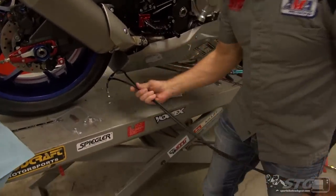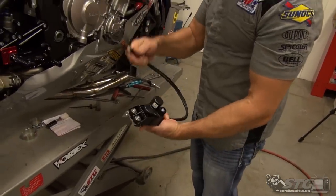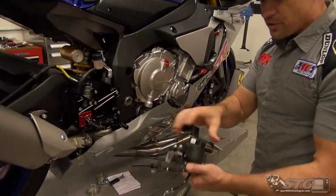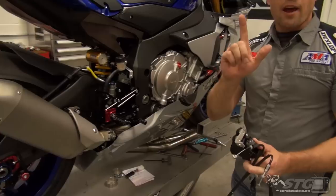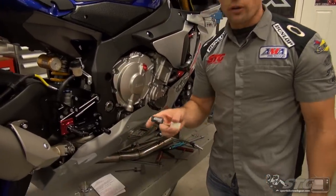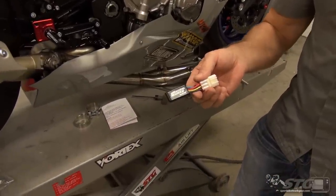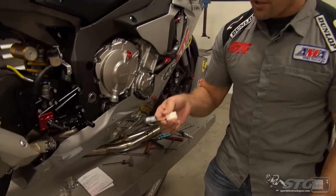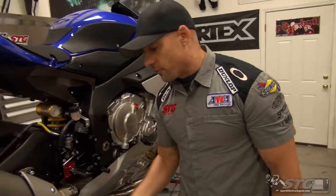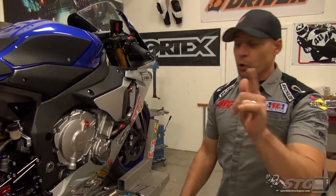Be prepared to deal with the exhaust servo as you go through the project. We've got our cables that hook up to the muffler box here and the servo motor. When this is all disconnected, you're going to have an engine trouble light and you'll want to take care of that. We already have a video on the site and on our YouTube channel that shows you how. We installed the ScooterNet Exhaust Servo Buddy — you plug it in to where this used to plug in, right under the seat, piece of cake, and it keeps that trouble light off for you. So that's been eliminated previously — look for the video.